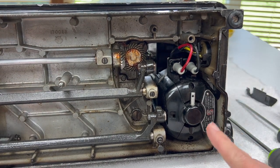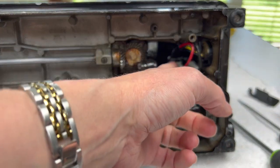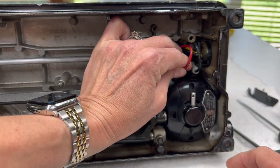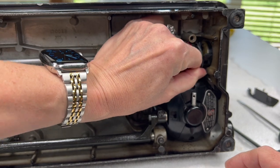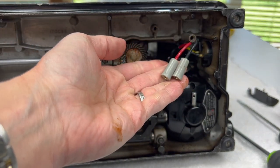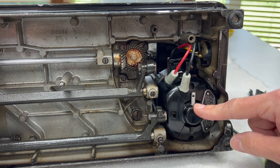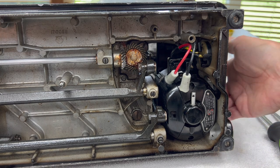Now we're looking at the wiring for the motor. We have two leads here that plug into little prongs on the motor and you want to pull these loose. Do not grab the wire here and pull — don't ever do that. Instead, make sure you've got a nice grip on the gray part and just wiggle it free. I always do the one on the left first so I can get a better grip on the right. It really is a tight squeeze with the hands, but you should just be able to pull it free. Now I'm going to flip the machine back up to see if this motor is just going to drop out or if I'm going to have to coax it a little bit.